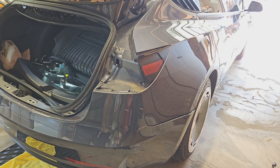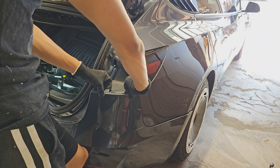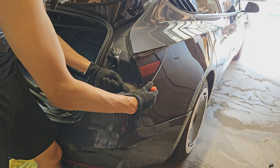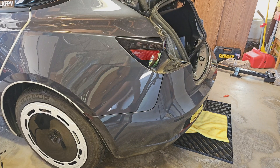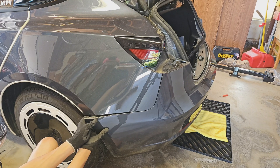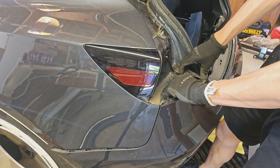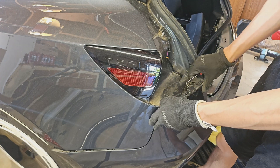All these clips are pulled out. Come to the top and pull up and away from the car a little bit to get the bumper over these clips. There we go — that's pulled off. Just got to get this last one a little bit over — use the pry pick tool a little bit. Now that whole thing is loose. Go around to the other side and do the same thing, starting on the side, just pulling the bumper away from the car. Let's grab it and put it down. All of these bottom clips have popped off as well. Pull over the top clips — that one's still going to give me a headache, so lightly try to pull it up and over. It's all over.